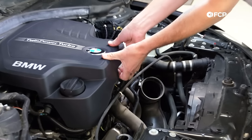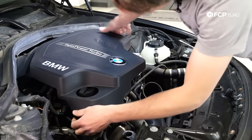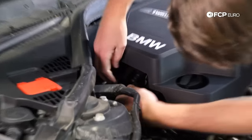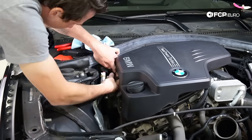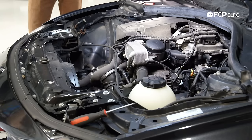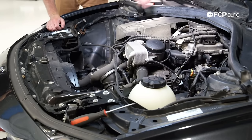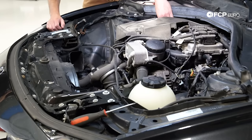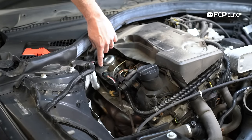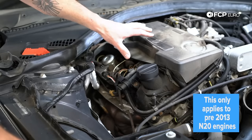This is a good time to stick a rag in the intake plenum so stuff doesn't fall in. Next we're going to pull off the engine cover — it simply pops up in the front and back. Disconnect the plugs here. On a higher mileage car like this one, the plastic becomes very brittle, so I found it's easier to disconnect the vacuum lines here rather than try to undo the plugs on the engine cover itself.